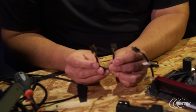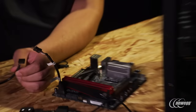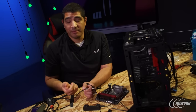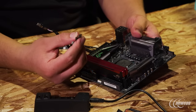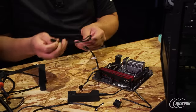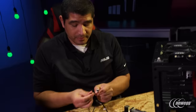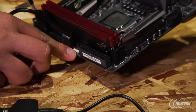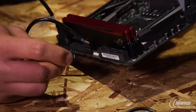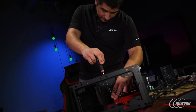In addition to that, you've also got this quick connector included inside the box, which allows for an easier level of connectivity for the front chassis leads — things like your power button. You connect this to the header on the motherboard and then connect the corresponding leads, making it much easier to run the chassis leads. Last but not least is an optional cable — the Asus Aura extension cable — which is great if you're connecting compatible LED strips directly to the motherboard for control. You've got your female and male connection, and you want to look for the Asus Aura RGB header, which is always a white header on our boards. Line up the arrow, which designates the 12-volt connection, and look for 12V on that header.